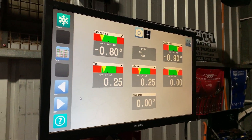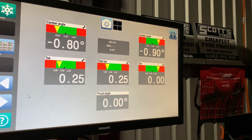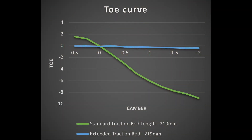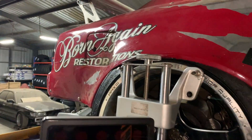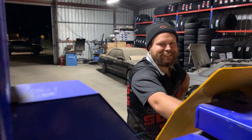So after the alignment, we're set up with half a degree of positive camber. We've got the car squatting now - full degree negative camber and the toe has barely changed, if any. 0.25 is nothing - it's a squirrel's amount. The car is definitely squatting right down onto the tyre, probably rub at that height. Pretty happy with that Kale? Looking good. I reckon that's the best we could do.